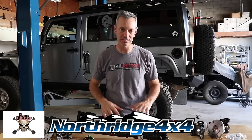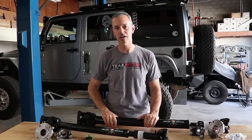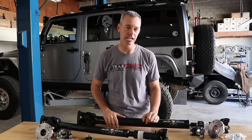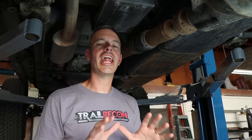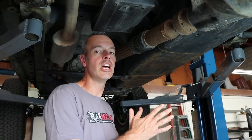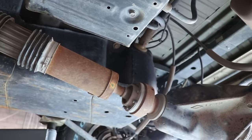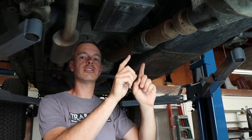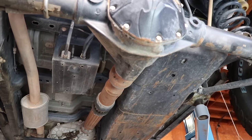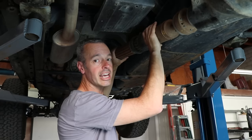At the end of this video I'll leave a link below — head over to Northridge 4x4 to pick up a set. They've got great customer service and great prices. Before we talk specifics and show the install, let's cover some basics about what a drive shaft is. The sole purpose of the drive shaft is to transfer power from the engine to the wheels. On a Jeep it does that through the transfer case — two drive shafts come off it. There's a lot of torque placed on the drive shaft so they have to be very strong, and they're spinning very fast so they need to be perfectly balanced.